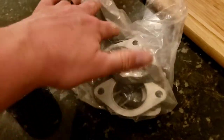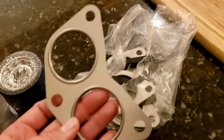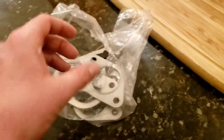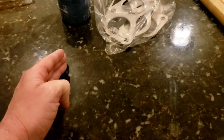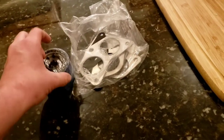Obviously, you don't need blow-off stuff. This is just gaskets because I buy whole kits at a time, so this makes it easier. And then you can buy some Grimspeed ones or whatever, and have them sitting around. But yeah, make sure you get the exhaust. So you got the two headers, and then you got the mid-pipe, and then you got the exhaust header to up pipe. Probably need at least header to up pipe and then the two exhaust ones. That way you can just drop it down as one piece. Get the oil pan out, slap your oil pan up in, new filter on.